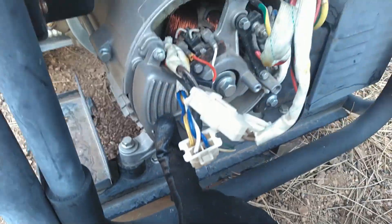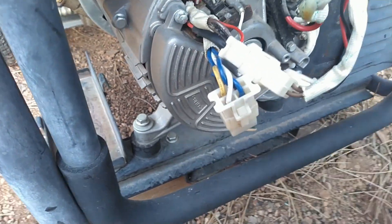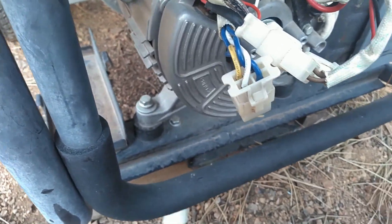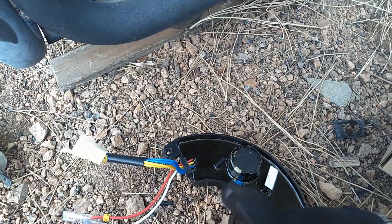I'm not even going to pull out the old AVR — I'm just going to wire it in place because we need to adjust it anyway. You're going to need a little tiny flat head screwdriver to do the voltage adjustment on this little potentiometer on the AVR itself.